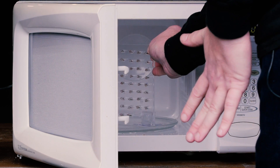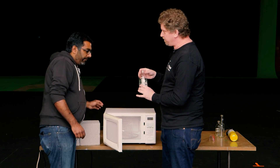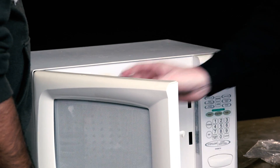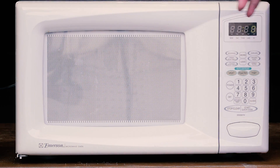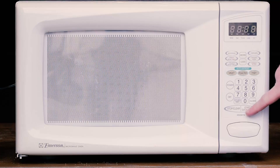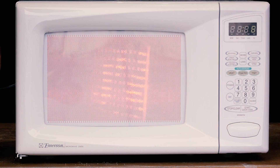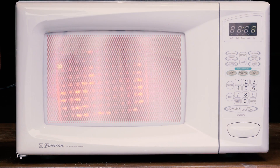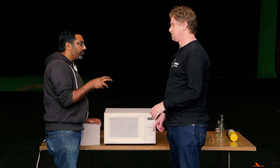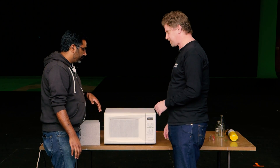You can see that some things — once the microwaves get absorbed by one thing, it can't light up the board. So we're going to put some water in. Even though what the water is doing is just generating that friction, it's still absorbing that energy from the magnetron, and so it can't go to other things. Oh, that's pretty dramatic with just a little bit of water. So now there's just not as much energy available — it's not that the glass is blocking the microwave radiation. It's pure energy absorption. It's stealing.